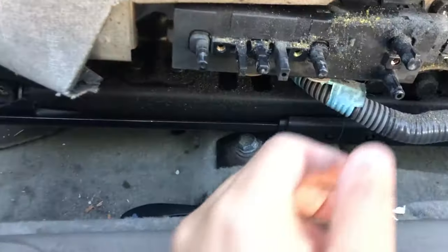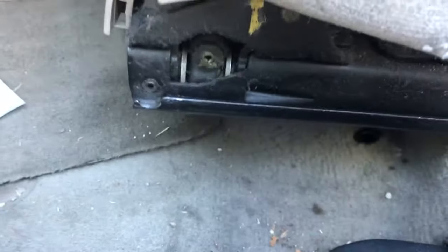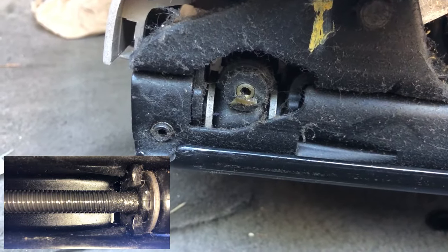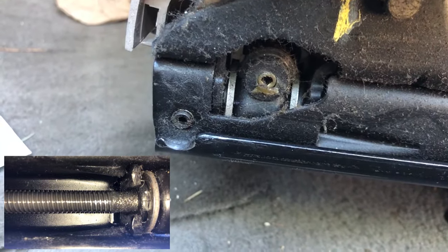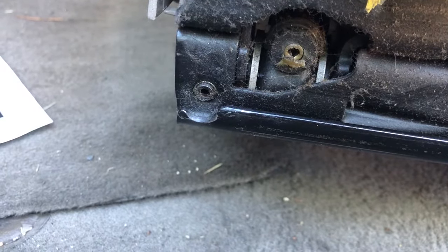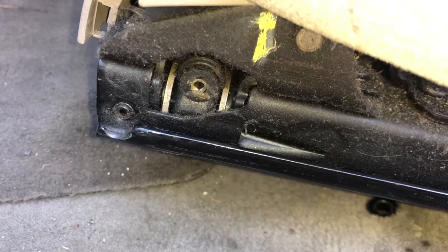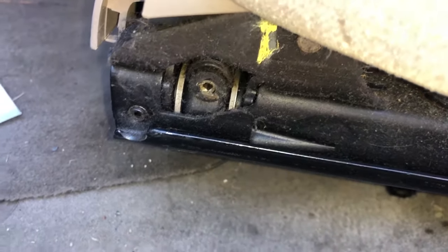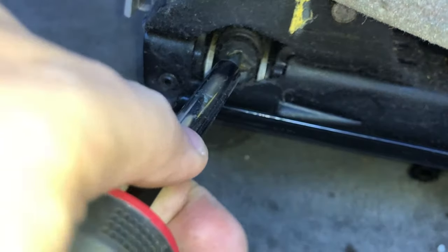Here's the culprit. If we move this one, you can hear a clicking noise — like it wants to engage. But if you look here, you can see it just gets stuck. It looks like the little actuator, the linear rod or whatever you want to call it, is not engaged with the rail. What I'm gonna do is try to screw this thing to the right, and that should cause the rod to rotate or move left so it can engage. You'll need a square bit — I don't know the exact size but this is what I found and it fits perfectly.